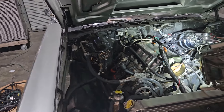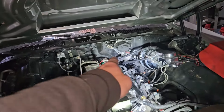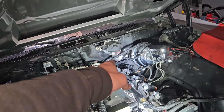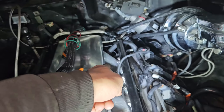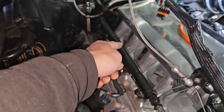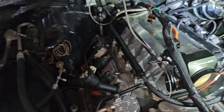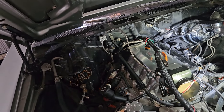I'm basically going to fix the throttle cable length — it's a mile long. It takes a sharp bend over there, then it was tucked down and up and over. What I'm going to do is take it out of the firewall where it's coming out on an angle, tuck it down between the back two runners, and come out either between the back two runners or the next runner up. That'll hide the cable a bit and give it a smoother curve.